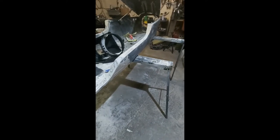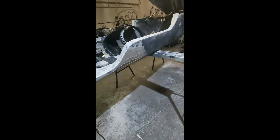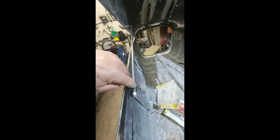Right, what I'm at today is more moulding, as you can see. Repairs and filling dents and getting all bits sorted out. I reinforced the hinges, as you can see underneath there, yesterday. What I've also done is I've redone these guys, and I've welded captive nuts in there, because I was a bit worried that the wall of the tube that I used wasn't strong enough. So it's plenty strong enough now.